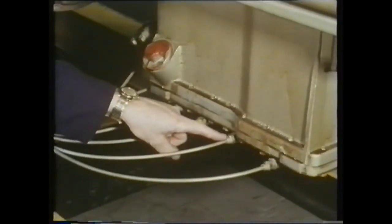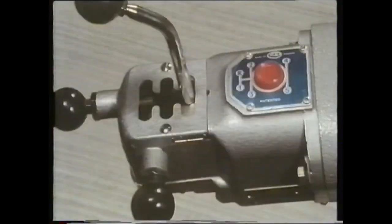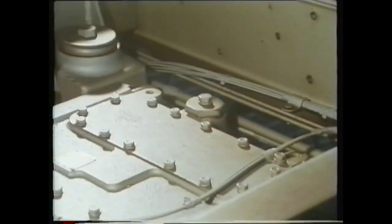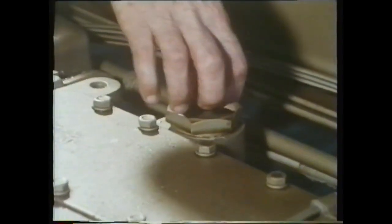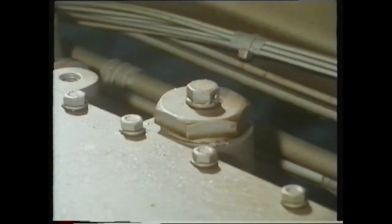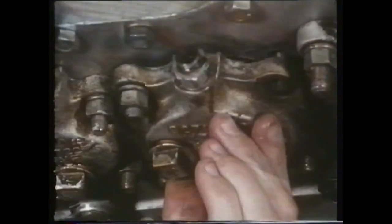If we now assume that air is present at the inlet to the gearbox when you make the first check on a fault condition, proceed in the following manner. First, apply second gear and return to the gearbox area and check the breather like this. If air is present here, then it's a clear indication that the second gear piston seal isn't functioning correctly and thus providing either a no-drive or a partial slip condition in second gear.